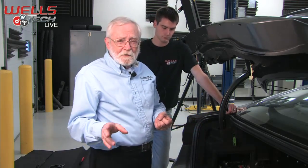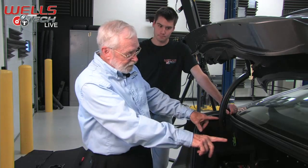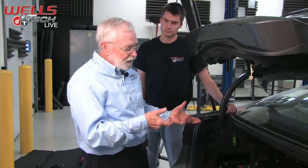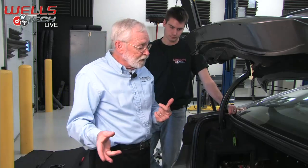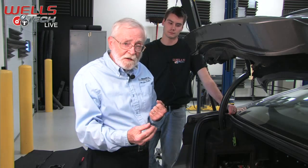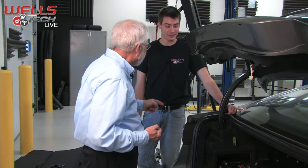The next step is a little bit tricky. The DC to DC converter runs on the high voltage and current that comes from the big battery. It's either going to be a connection inside the battery pack, like on this one, or there's going to be an orange wire that goes between the battery pack and an external DC to DC converter. In any case, it's going to be a shielded cable, and you're going to need to figure out if there's power on that orange wire to the DC converter. And I'm not hooking my voltmeter to it to find out. Right, that sounds dangerous.